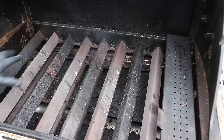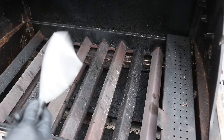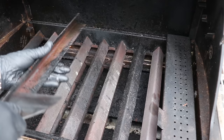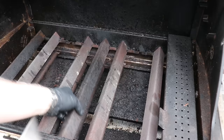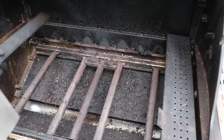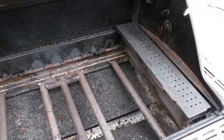Now we've got access to the flavorizer bars and the smoke box. We're going to remove any excess fat that's built up on the flavorizer bars. Use a scraper like this — and don't forget the underside of these bars, you'd be surprised how much junk collects there. Go down each flavorizer bar removing any rendered fat, cheese from cheeseburgers, really anything that's built up. Then we'll put these in the hot water soap bath as well.